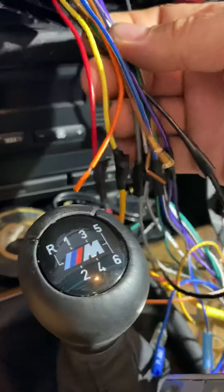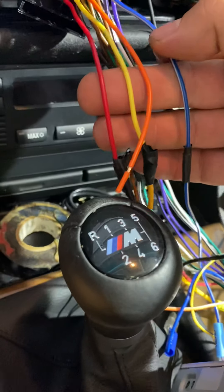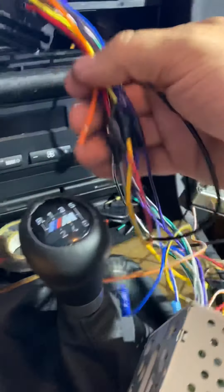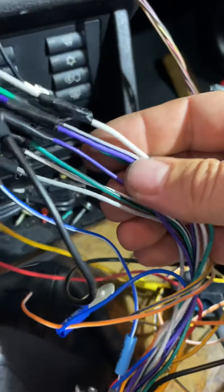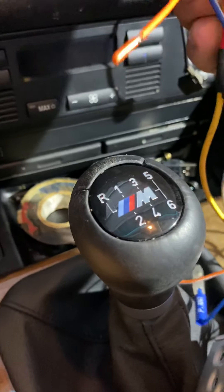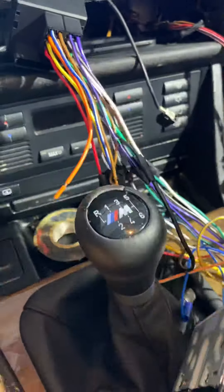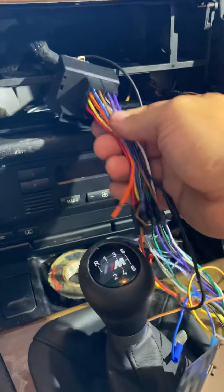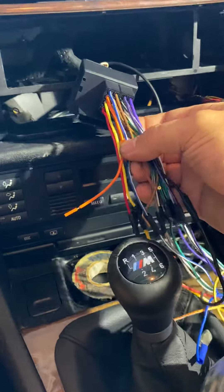To recap: four very important wires — ignition, ground, remote amp turn-on, and constant. They all link up by color from this harness to my Alpine double-DIN unit. Follow all the speaker wire colors. The only wires I didn't use were two brown wires and one orange wire. In the back you'll have four wires in total. From the Amazon harness, use every wire except those two brown wires and the orange wire.